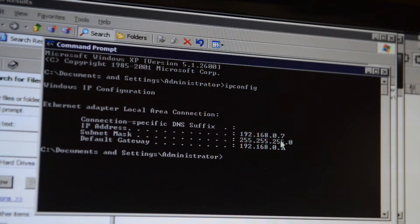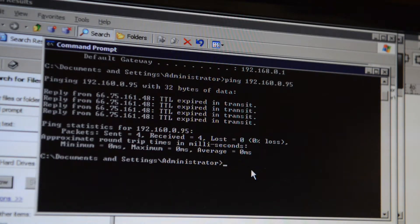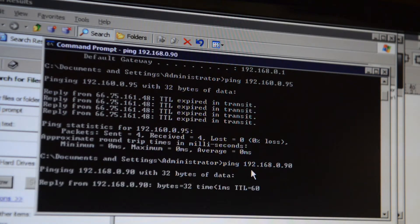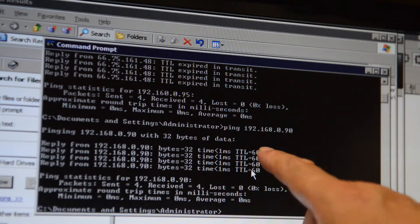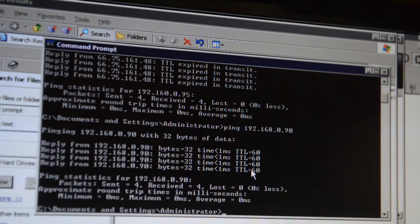This IP address you see here stands for the older IP address that has been disabled by the new router's installation. So what I should do is alter the last digit from seven to something else. I tried 90 to replace seven and it looks like it is working.